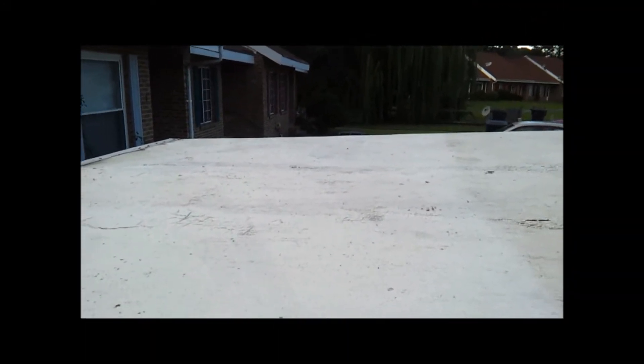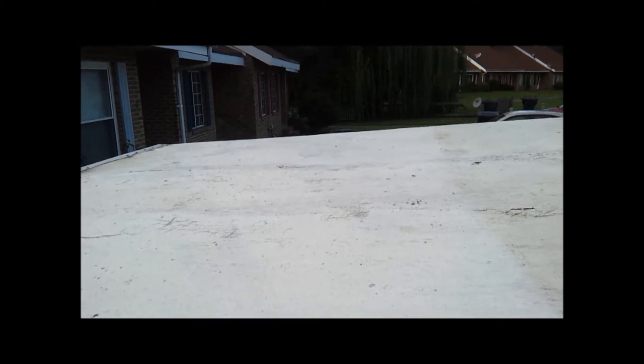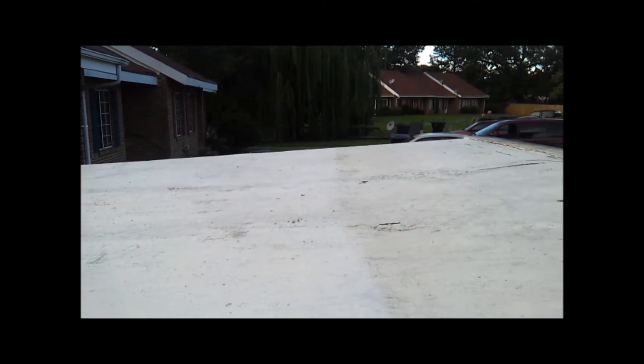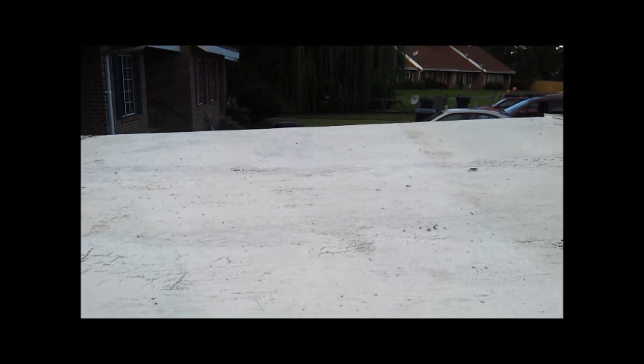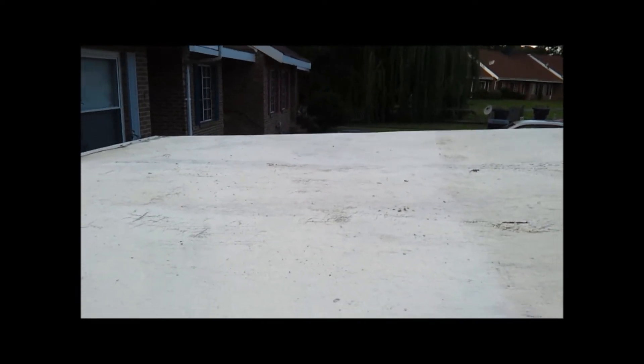When I built my trailer, I made one flaw in the plan — a pretty good size flaw. That flaw was I had a flat roof, thinking it would be fine. However, with the flat roof, it gave me areas where water would puddle, because the plywood being a half inch thick, just being flat, it'll bow a little bit in those spots and give you puddle areas, which in fact makes a mess.